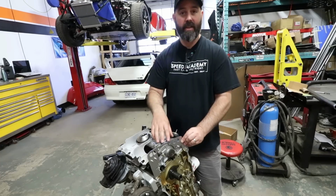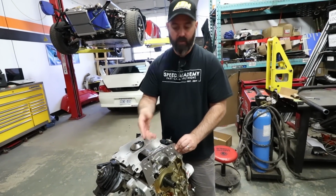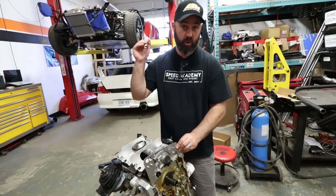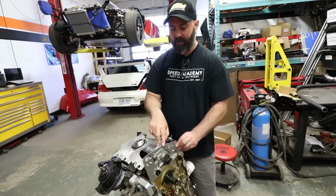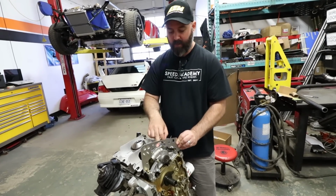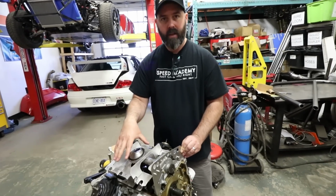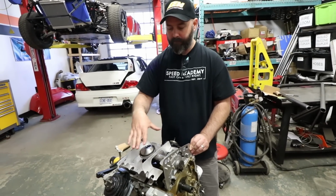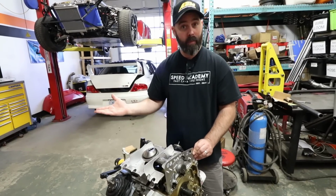So there's been guys who actually data logged their oil pressure in S2000s with K motors in it, and we're seeing their oil pressure drop to 0 under hard braking. And this is designed to prevent that from happening. So this will go a long way to keeping this motor alive in our rear wheel drive S14. And this guy we'll modify as a more traditional baffle setup to keep oil in that left to right corner scenario. And I think at that point we'll be good to go.